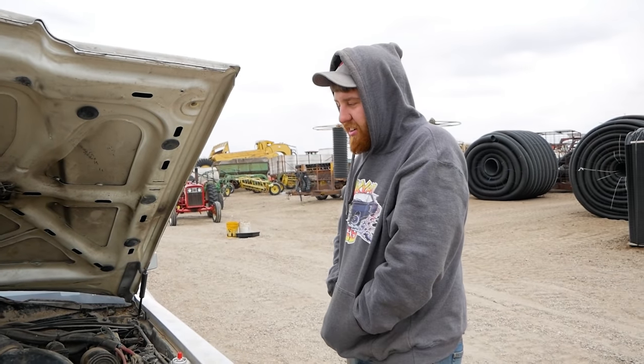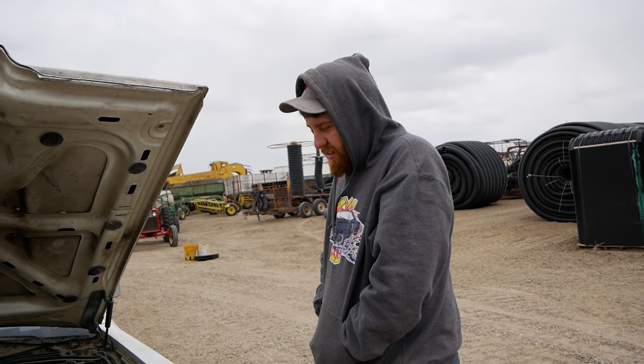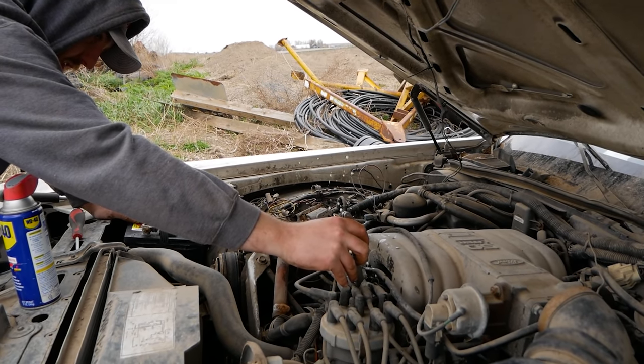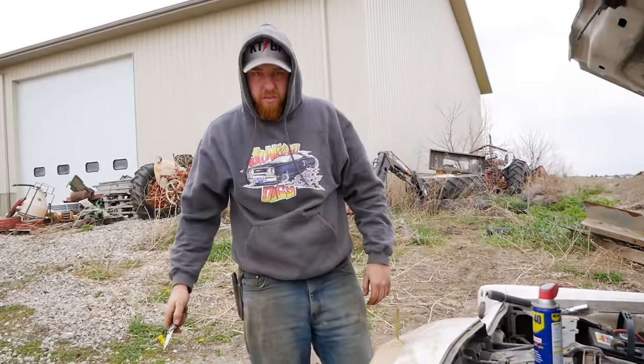Ever so slightly to run. It got a little higher pitch. Yeah, I was like, I gotta wonder if someone before us or us ran old gas through this and the valves got sticky and they're not closing in time.